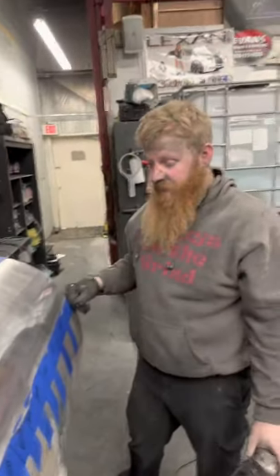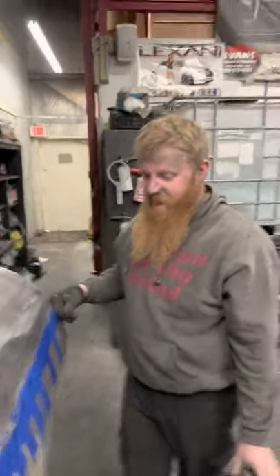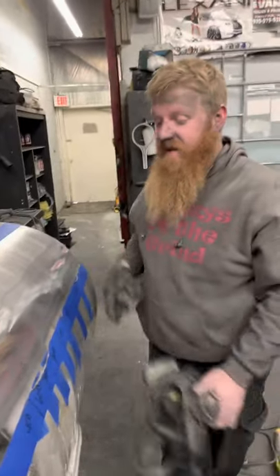So I got to ask you, when you're buffing I see it jerking quite a bit - what are you feeling? It hits a solid. As soon as you hit that 1,000 grit? Because look at this - it drops the compound. I want everybody to see this. You can see the 400 and 600 here is a pretty distinctive line - it's at least shiny. You could hit that a second time and it would be really nice gloss.